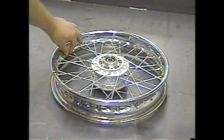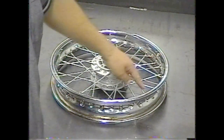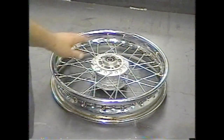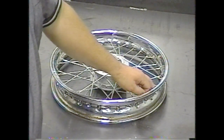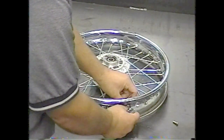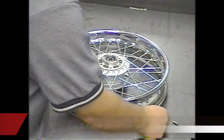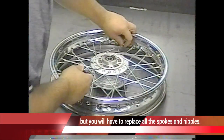The next step is to remove all the spokes from the wheel. The fastest way is to use a grinding cutoff wheel and cut all the spokes off — it's faster and easier. But if you have new spokes and a new rim that you're repairing, you would want to save the spokes, so go ahead and loosen them all up. Anything that's rusted, take them right off. A spoke wrench would normally be used to loosen them up, then you can use your fingers to remove the spokes. It doesn't matter what order you pull them — just start removing spokes until they're all out.